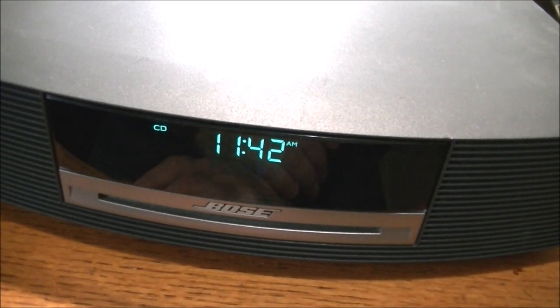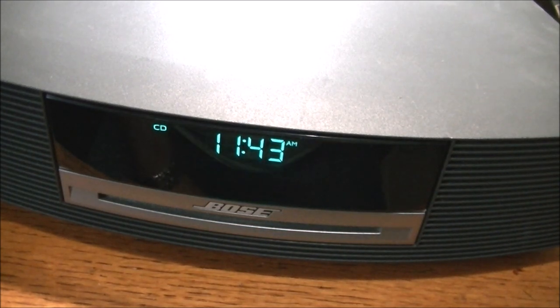There's a way I can adjust the actual voltage to the CD player — I believe I can turn a little trim pot inside the CD player unit itself to increase the voltage getting to it, and that might rectify this. To do that I need to keep the CD player in a cold, non-functioning mode and do a slight tweak of that trim pot. If the CD plays well afterward, I know I've helped the CD player read properly — but it also tells me the components are definitely in need of replacement.